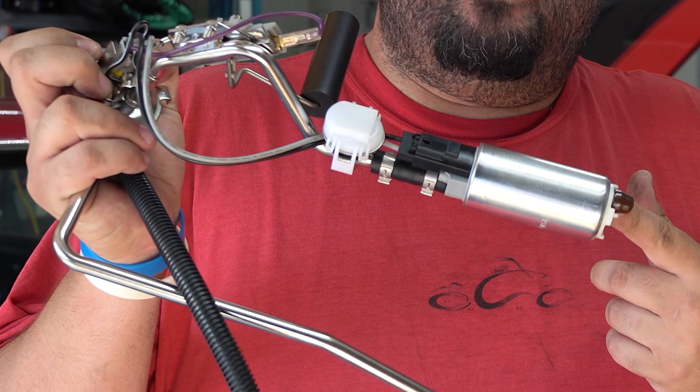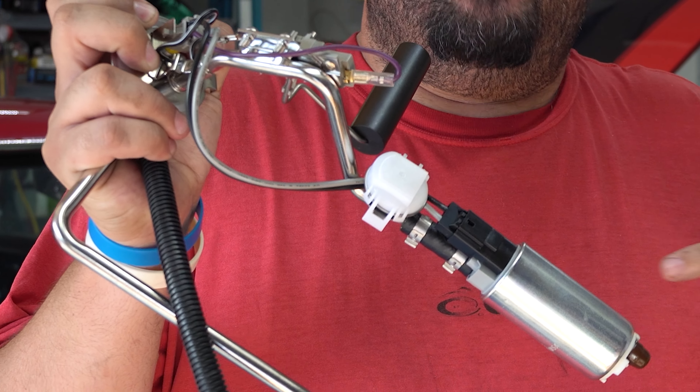Probably what scares people most is: do you need to modify the fuel system? It really depends on what you have. If you already have a fuel-injected system with a high-pressure pump, just regulate it up or down to whatever PSI you need. For the Holley Sniper Stealth I installed on the Camaro, it needed 58.5 PSI to run correctly. Luckily the Camaro has tons of parts available — there was an in-tank setup with a built-in regulator and pump, so I used the factory hard line and just ran the EFI line up to the stealth unit. Really simple and clean.